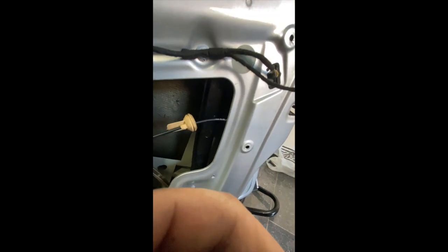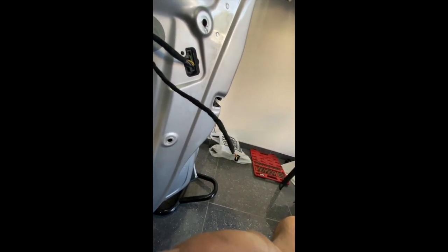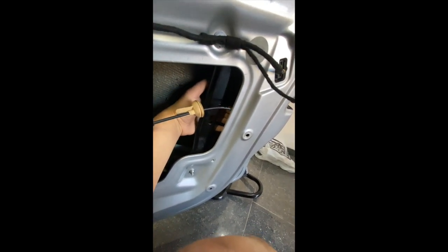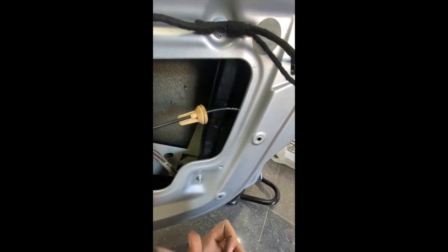Your door lock is inside here — it's very hard to get this on camera. All you have to do is remove this connector, open your two M6 bolts, and once you have it out, just bring it forward, remove this cable which slides out, and then you're going to have to slide the lock into position and twist it over to remove the lock.